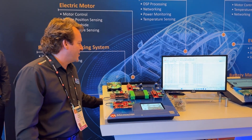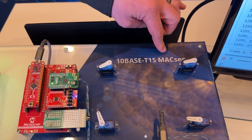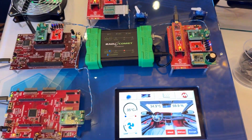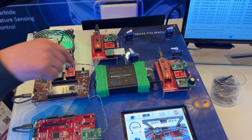Hello, Intrepid team here at CES 2024. We are demonstrating our 10BASE-T1S demo, really highlighting MACSEC, and we're able to watch all of the traffic on this twisted pair Ethernet in-vehicle network and monitor the traffic with the Intrepid tool here, which you can see the output using Wireshark on this monitor over here.